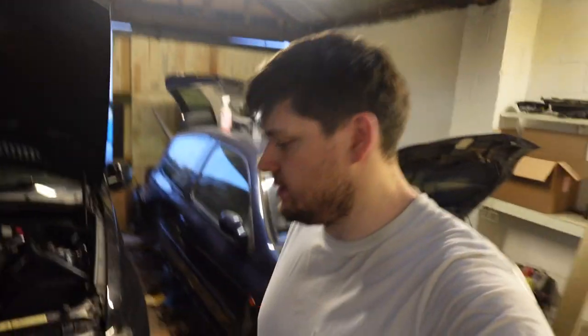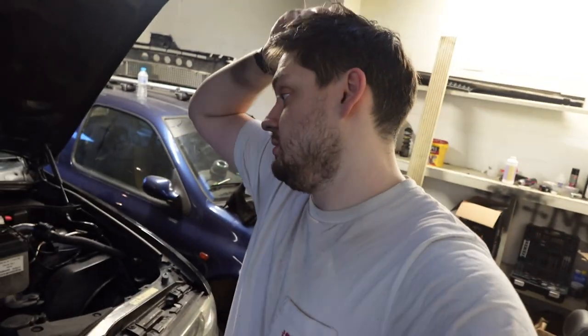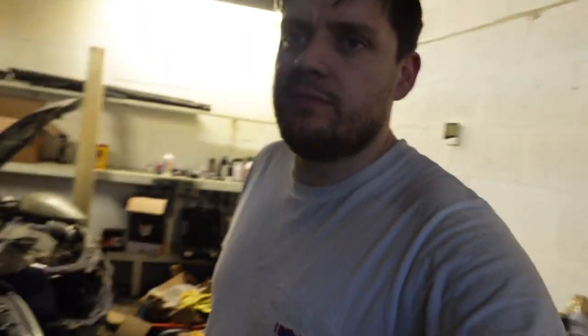Yeah, that's embarrassing. Something's leaking badly — I don't know if it's the exhaust or what. I've tightened everything down that I could see and it's making a horrible noise. Next time I'm going to take the exhaust off the downpipe and just check that seat properly because it doesn't look quite right. I'll also check that I haven't starved the turbo of oil or something — but it shouldn't be. I let it idle for a bit before I gave it some revs and then it just sounded like something was pissing air.